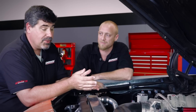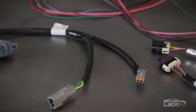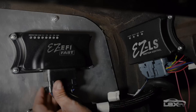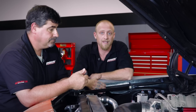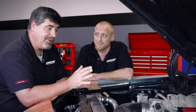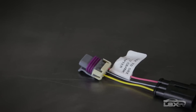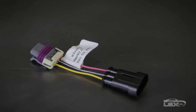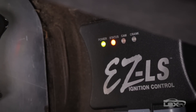In total there are 14 different electrical connections to make, everything from simple power and ground to zero-to-five volt signals and the CAN bus connection that handles camshaft and crank position data. It's extremely important to verify the CAN bus connection by checking the status indicator on the unit. The system ships defaulted for a 24-tooth reluctor wheel and a single-pulse camshaft, but an adapter is included for a 58-tooth wheel and four-pulse cam. LED indicators on the unit also confirm your power, cam, and crankshaft signals.